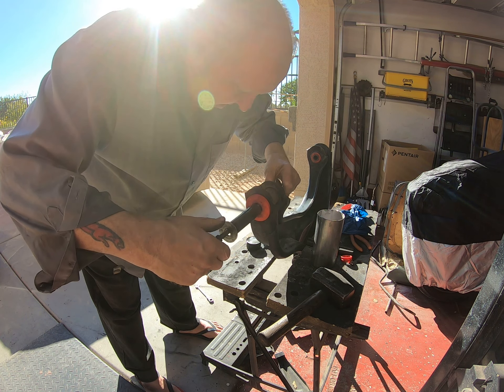Here is the lower control arm - another big unit, and that was an absolute pig to get in. I did it in the press with cups and a big piece of plumbing pipe over the top, then a metal piece to push it down. The bugger wanted to go in crooked every time. In the end I started it by lining it up, put the pipe on, tapped around the pipe to get it starting straight, and then put it in the press. By god, that is tough.